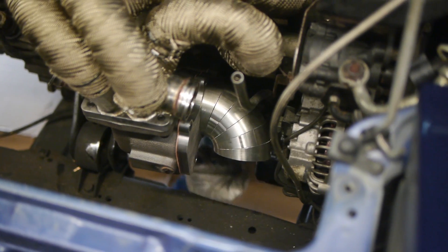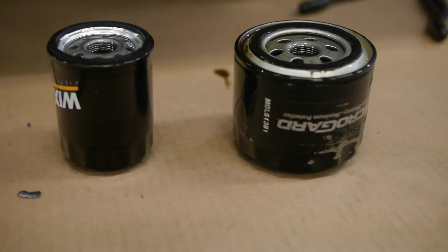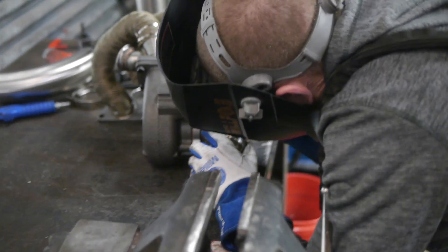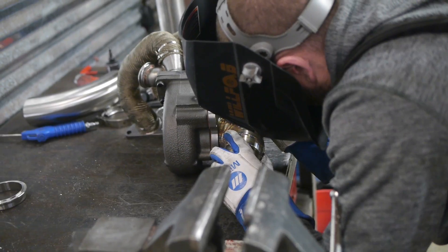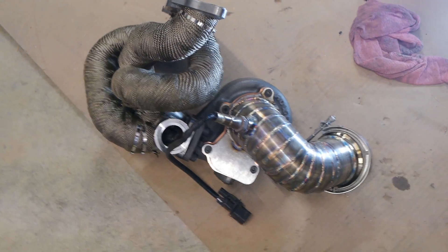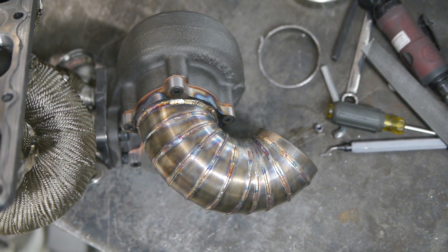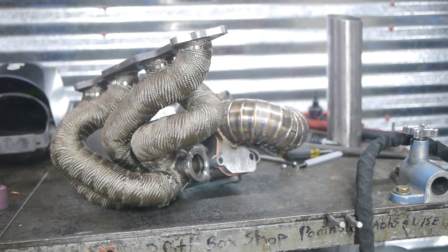You can see here that we just can't do a 90-degree bend down because of where the oil filter sits, so it has to come forward and then curve back down around to miss the front cross beam. In order to give us a little extra room we're also switching from a 1G DSM oil filter to a 2G DSM oil filter, which is going to give us a bit more room to work with. Once all that's done the pieces are tacked together and then Willie starts welding them up. This is a good shot where you can clearly see the compound curve going on with the downpipe — it's pretty cool. I am dumbfounded how fast he put this together. The test fit was so brief that I didn't even get a good shot of it. He's just like 'oh perfect, got it' and started welding it up.